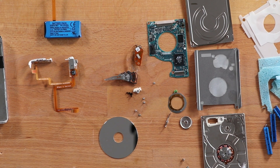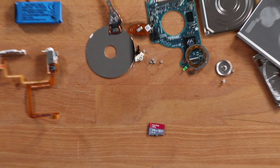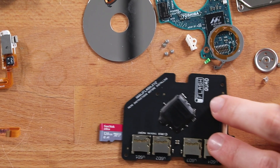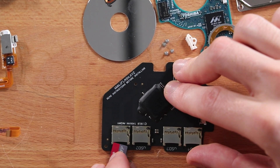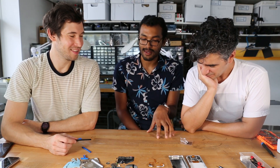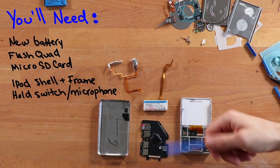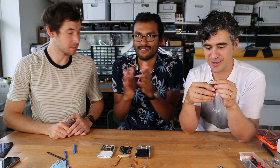It's so sad that we don't need it anymore — forget all those mechanical parts. We have this tiny little microSD card that will hold more than four times the amount of memory, and we're going to place that into this, which could hold three more. But there's one caveat: there's a certain number of songs that iPod can think it has. So even if you put four 128-gigabyte cards, it would only read up to a certain number and wouldn't know about the others. I only want 128 anyway because that's already insane. So now that we've taken this all apart and installed the memory in the new hard drive component, we're going to reassemble all of this into a brand new, better iPod. Assemble, go.